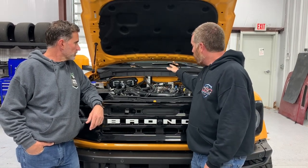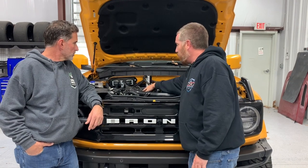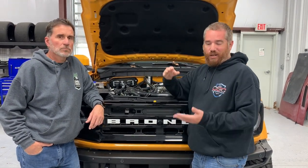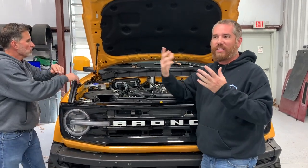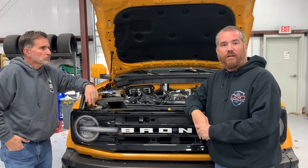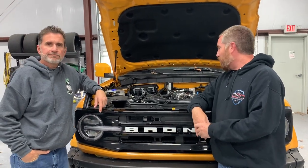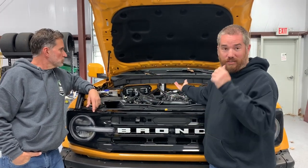So the whole purpose of the PCV system is that you have a vacuum source on your crankcase that helps with engine efficiency, that helps with emissions, a whole lot of things for being 50 state legal and all, in the current atmosphere of vehicle manufacturing. So the byproduct, of course, of that is blow-by and it being sucked into the crankcase.